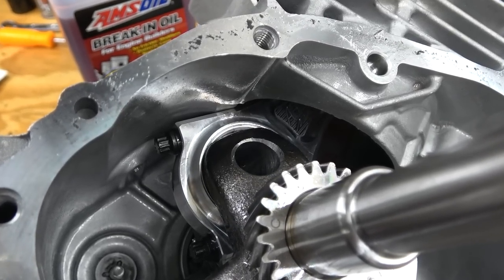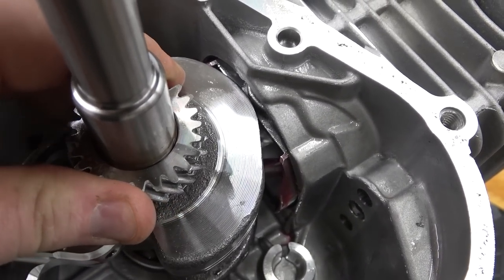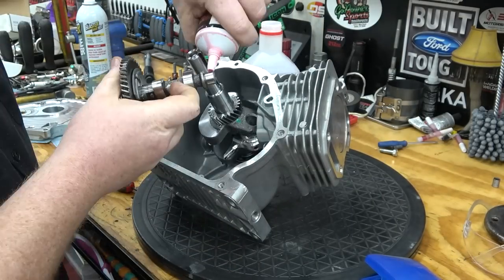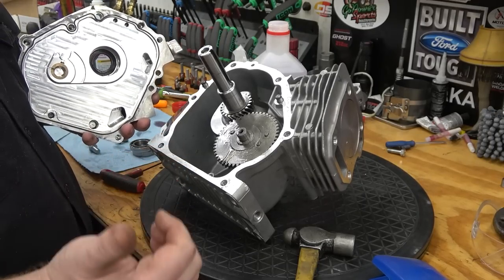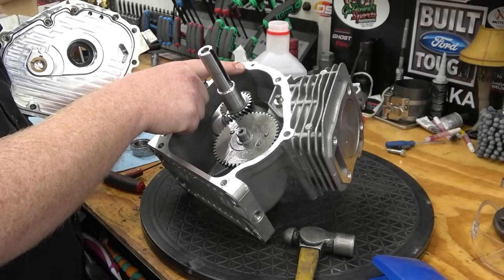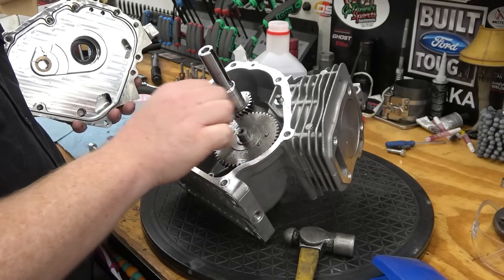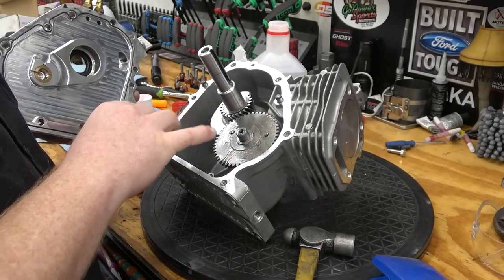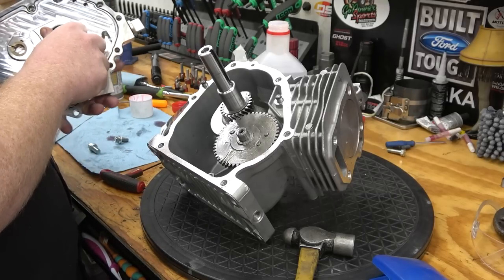We've got a few spots making contact on this new block, so we'll have to do some clearancing in the block and on the crankshaft before we continue with the build. This must be a new version of this block because the old block casting was a lot worse shape than this one — this new engine looks miles better in quality. Looking at these two blocks, they're actually a little bit different. The old 224 had the lower dowel pin hole; this one only has the upper and it's super tiny. The most important thing is keeping the two original ones and putting the solid dowels in. I've never had a problem just running two, so we're going to be running the two in the original spot.